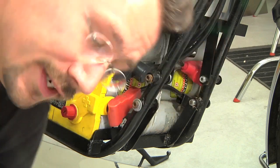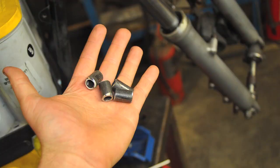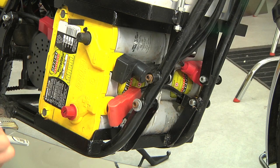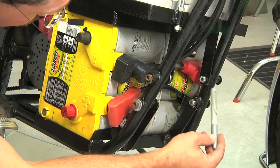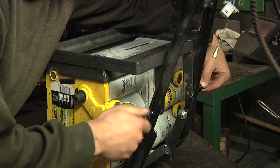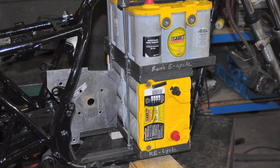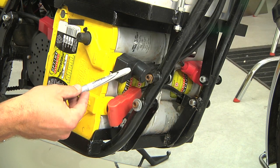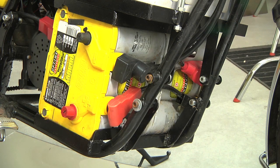Here's an alternate view of the front. You can see I welded some little bits of steel pipe for the threaded rod to go through. Down here we have the plates that go from both the bottom and the middle down to existing connection points on the frame, and those just use a bolt with a nylock nut. Always use either nylock nuts or split-ring washers — anything that's going to keep things from coming loose. Alternatively you could use thread lock. Any power connections are covered with rubber boots, and any unused connections are also covered.